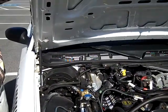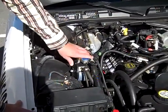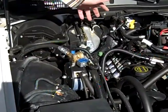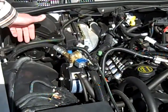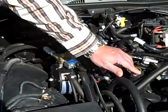...you have a fuel tank, just like the gas tank. From there, the propane runs up into this component here called a reducer. What the reducer does — it has lines for the cooling water that run into it. They heat this thing up, and when the propane comes in here, it heats it up and turns it into a gas.